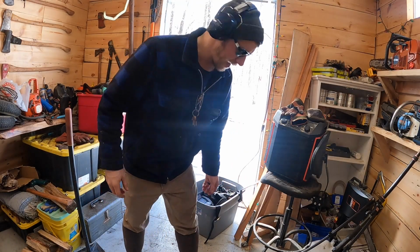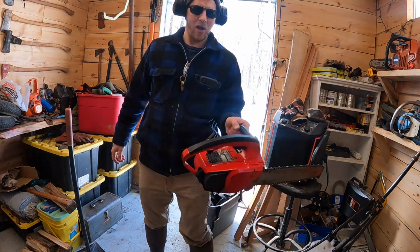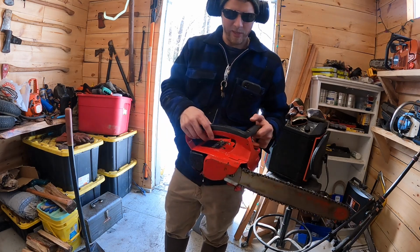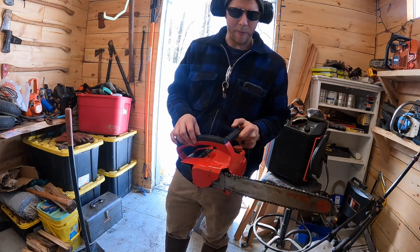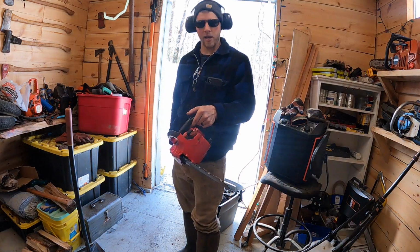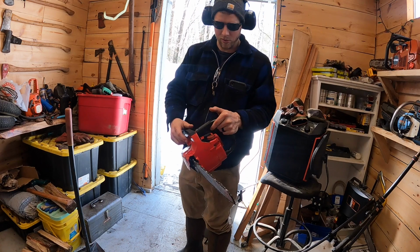All right, folks, check it out. This is the Homelite Super 2. This is the one that didn't have spark when we did the original diagnosing video. What did I do? Took the starter cover off, took the flywheel out, cleaned the points, and shebangaboodle. She's got spark.